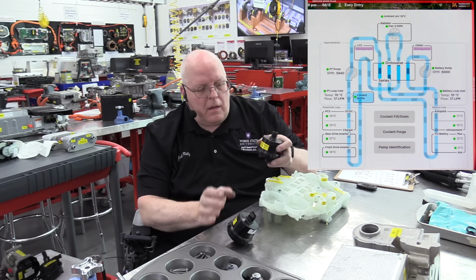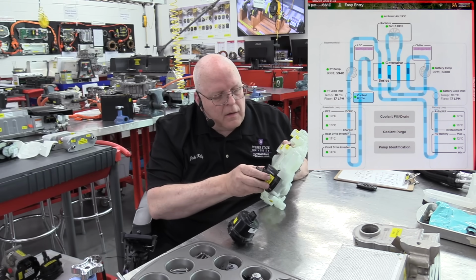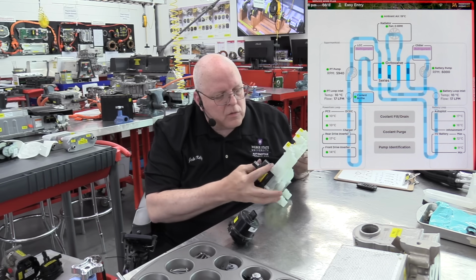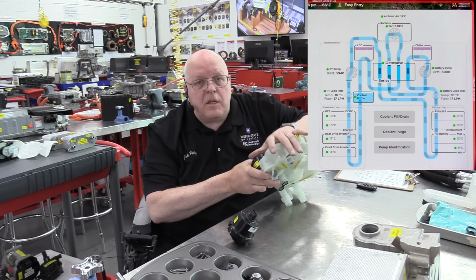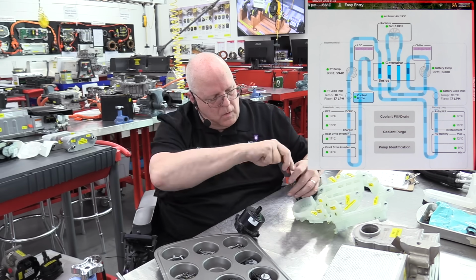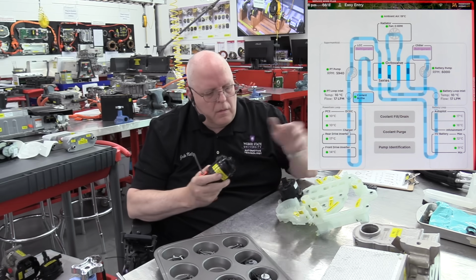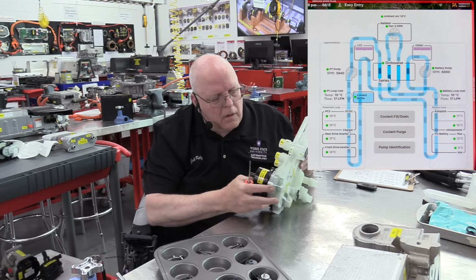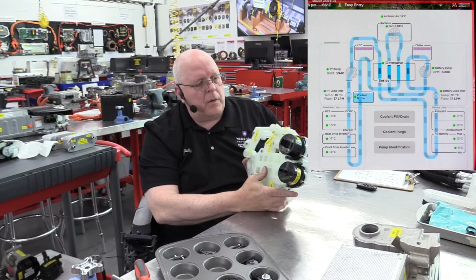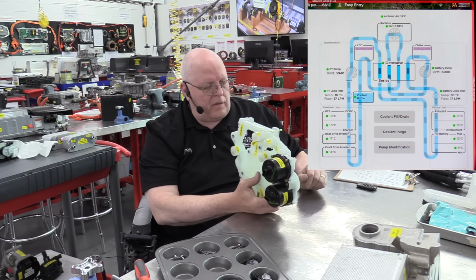The battery coolant pump goes at the bottom down here, and so we will plug that in. It matters its orientation. I think it only goes one way, but these pumps are serviceable. Put the screws in it to keep them from falling out. And then we have the powertrain pump also, and it only bolts in one direction. Okay, so now we've got our 2 coolant pumps installed. Powertrain pump at the top, high voltage battery pump at the bottom.